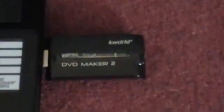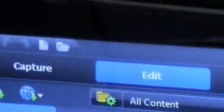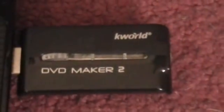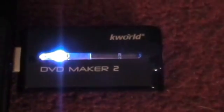Now with the capture card in the laptop we're ready to record with PowerDirector 8. Fire up the software — when it first loads up it goes to the edit screen and brings up a load of JPEGs that came with the software. We're on Edit, but what we want to do is go over to the Capture button. Click that, and you'll see it start flashing blue, then stay lit blue as it registers the capture card.